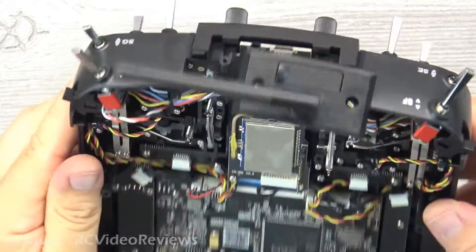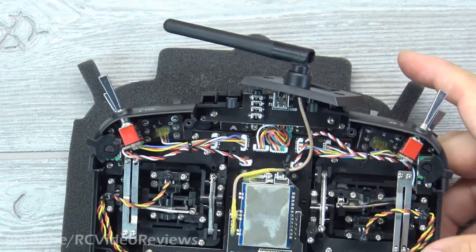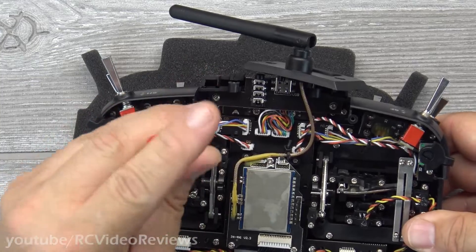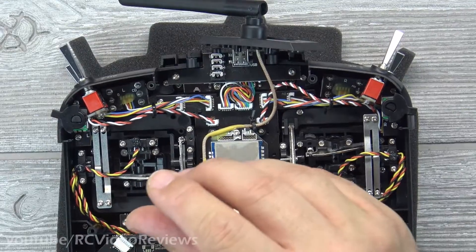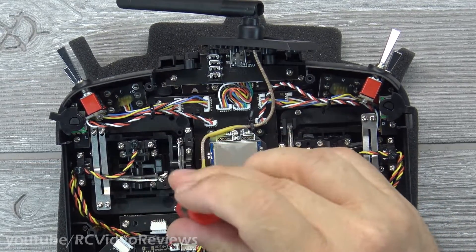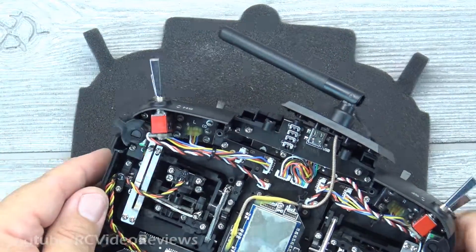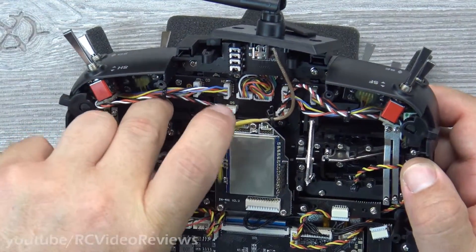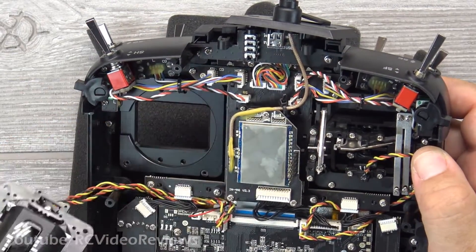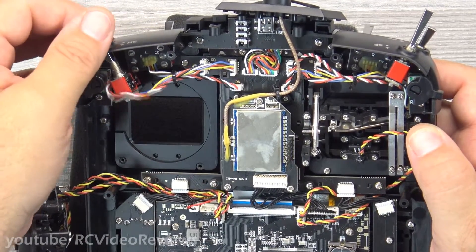If you don't have the tool it's really easy to slip off and scratch. In order to make this work, the gimbal has to be removed. There are just four screws — you can see where they are just by looking at it. I know this looks scary, but it's not that hard. Just a couple of screws and the gimbal slides right out. The main thing is making sure you put it back in the right way, so take a picture or look at my radio before you do it.